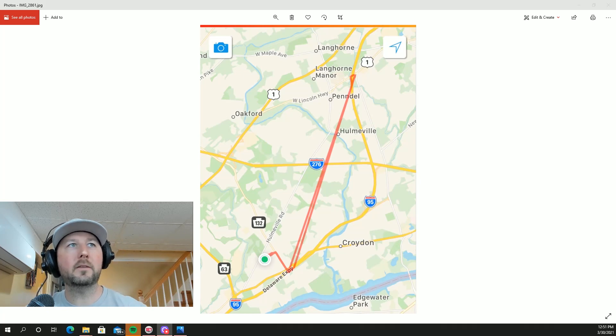For this test today, it's going to be a light test. I call it a light range test because I'm only traveling a short distance, just to get an idea of having a car charged roughly the same amount on the same exact route with the same weather conditions and within almost the same amount of time. Doing the first leg of the trip with no roof carrier on, recording the watt hours per mile and the range traveled, and then immediately putting the roof carrier on and repeating the same exact trip. This is the trip I routed out — a stretch of I-95 just outside of Philadelphia, relatively flat and straight. A really good candidate for putting autopilot on, going up, doing a U-turn, coming back the same way, and repeating the process.